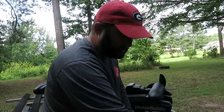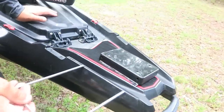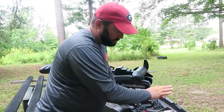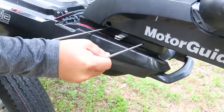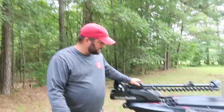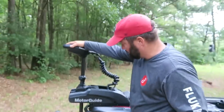With a Bonafide kayak you're going to have to put a spacer — we got a piece of PVC paneling from Home Depot and cut it down to fit underneath there so you can get the rod up above. Every kayak is going to be different, so you'll have to pick and choose how you do that. Let's put it back on — it clips in just like that and it's ready. We've been running it for about a month and a half to two months with no issues. To deploy it, push this big button right here and push it out. Be careful — there's nothing to stop it from free-falling, so you've got to hold it.